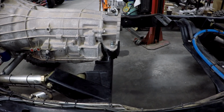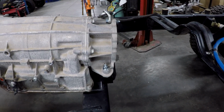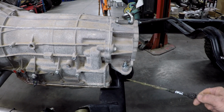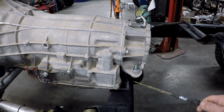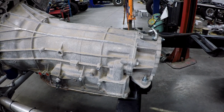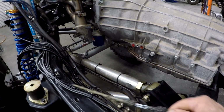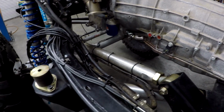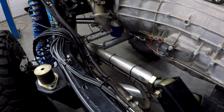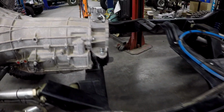And if this customer insists on having a flat belly, flat skids, then we're going to mount this transmission mount directly on top of here. We're going to run flat skids. We're going to have to wrap the pipes, keep the heat out. I've seen, and you see all this stuff he's got run here, I've seen the ARB lines in this plastic for lights and cameras literally melt when you have full skids and you don't wrap the exhaust pipes. It turns this space into an oven. So what are our options if we run the flat skid?